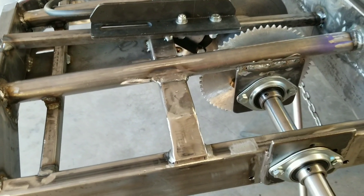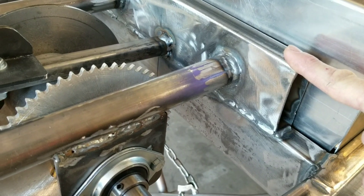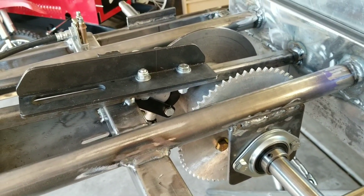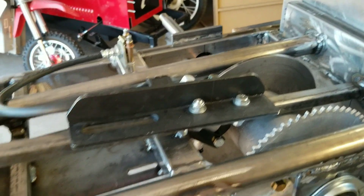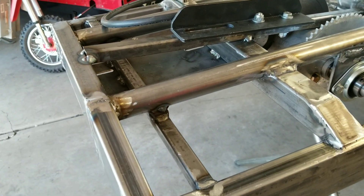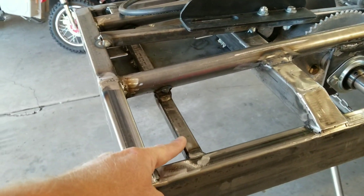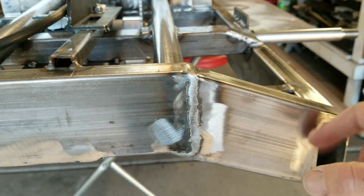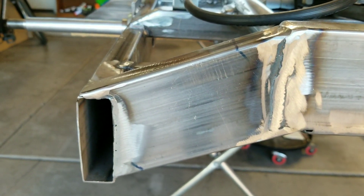I've got the frame flipped upside down — this is the bottom of the frame. You can see this extra piece of one-by-three square rectangular tube added here. You could use round or square; I had some round remnants I bought cheap, so use scrap where you can. You can see there's a cross member and a smaller cross member to hold the motor plate. The motor plate is also held in place by the one-by-three at the back, where I did some miter cutting, made templates, framed it in, and ground the welds flush since it'll be hidden by bodywork.